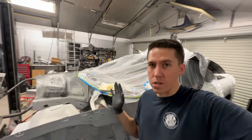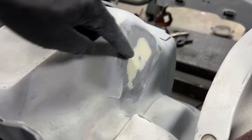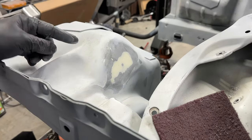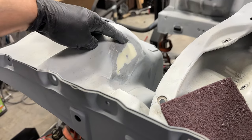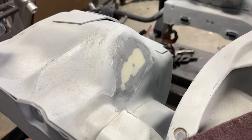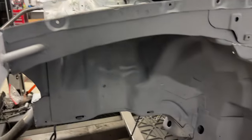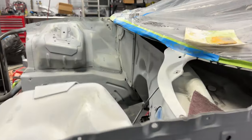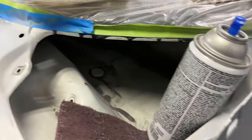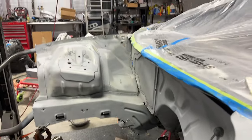This is the rough part about building the car and trying to paint the engine bay and make it nice. I got little spots like this that have just a little thing there from where I picked off the old bracket where it went up to the hood. It had little dents in there from where I was using the screwdriver to pry up on the metal. I saw it when I was priming it with primer, so I came back, put a little bit of filler in there, sanded it smooth, and so on. I'm working my way over to this side - this side's all scotch brited. In the car there's also this weird pocket now because I cut all that, so I'm trying to scotch brite that, but then there's a bunch of stuff in there, so I've got to blow all that out and wipe it out a few times.